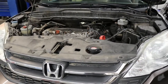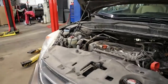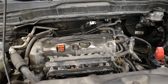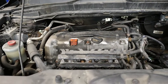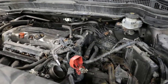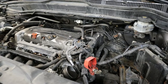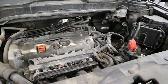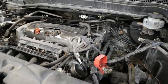Joe from Boulay's Garage here. I have a 2010 Honda CR-V here that was brought to me. It wouldn't start and it didn't have any oil in it — basically about a quart left, and what was left was very black. Now this engine is seized up, worthy of an engine replacement, and it only has 100,000 miles on it. Honda's are noted for great reliability, however you do need to change your oil. I've seen it a lot where people will go 7,000 to 10,000 miles between oil changes based on manufacturer recommendation, and that's not always the best thing to do given your driving habits and whatever else you might expose the car to.